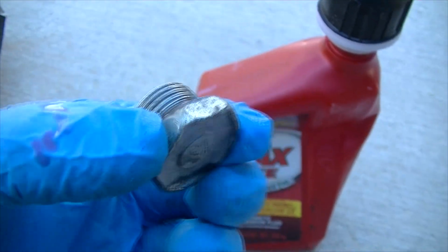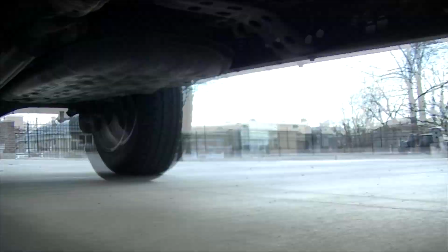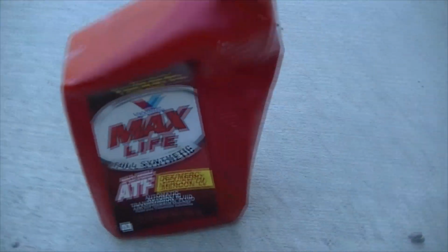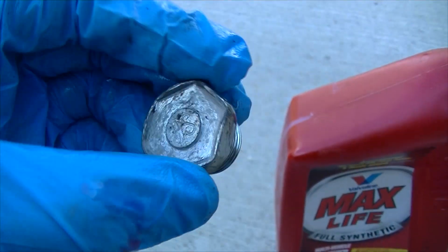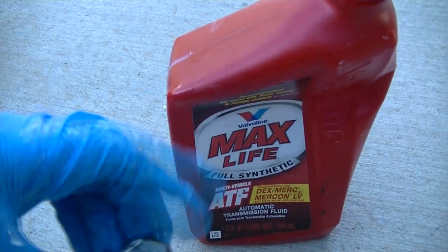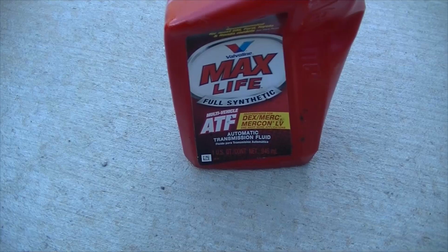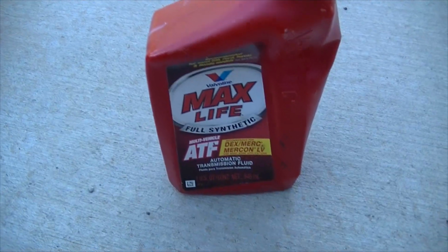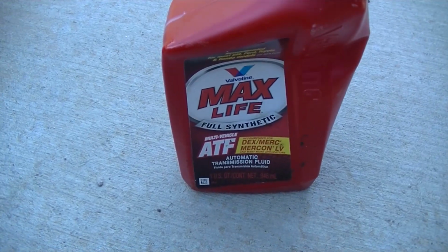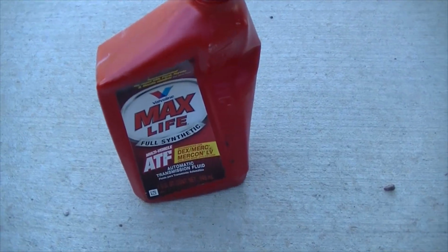Also, by the way, if you don't know how much fluid your transmission is supposed to have, you're actually supposed to drain out the whole thing using this plug right there, and then measure how much fluid you actually have, and then just replace it back with that exact amount of fluid plus about a half a quart more than you initially had in there. So yeah, keep that in mind. But as always, either consult the link in the description for the full detailed tutorial on how to check the fluid and all of that, and also check the owner's manual for the recommended amount and that kind of stuff.